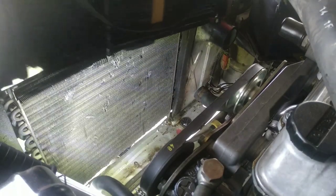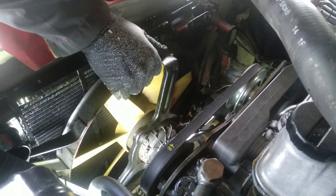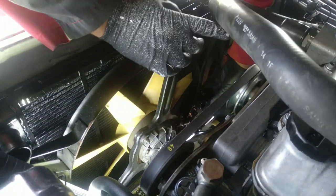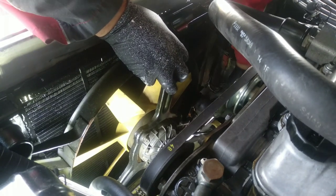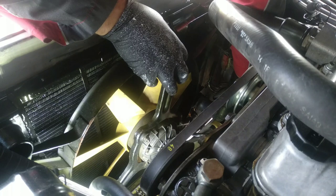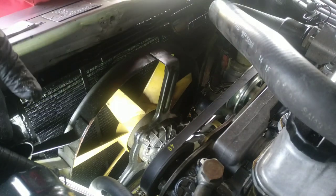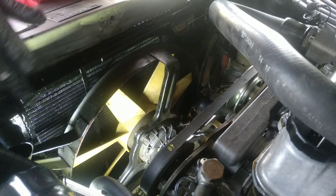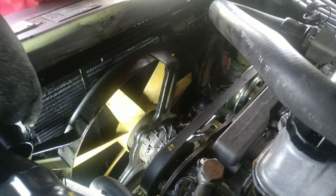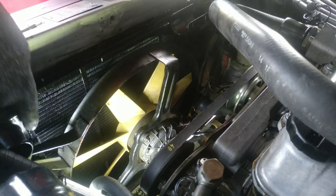So, why do you think this leak happened? Because it's old or bad quality? None of the above. This leak happened just because of lack of maintenance. This radiator is composed of the center part and the two plastic parts that hold most of the water, and they are held together by clamping force and an O-ring, a sealant on both sides.